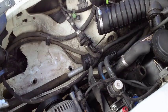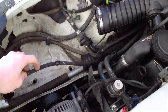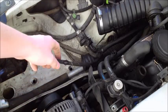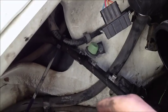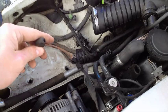There are a few things you want to do before installing your new filter setup. The first one is taking the hose you disconnected from the air box and zip tying it over here, because if you don't, it will rub against the alternator belt. I've done that and it frayed a little bit. Once you have it zip tied, you can cut the excess and it will be ready to go.